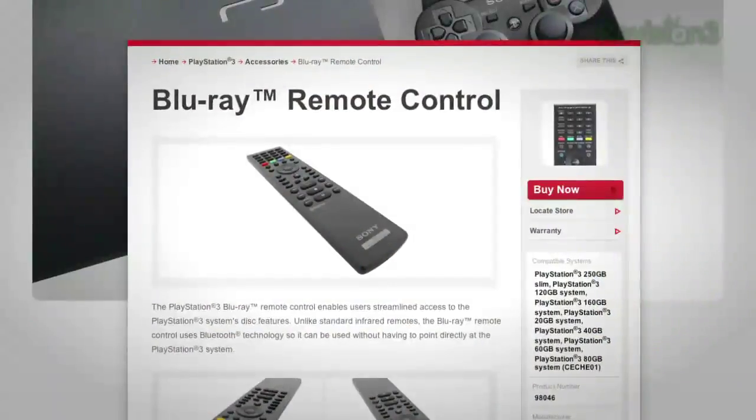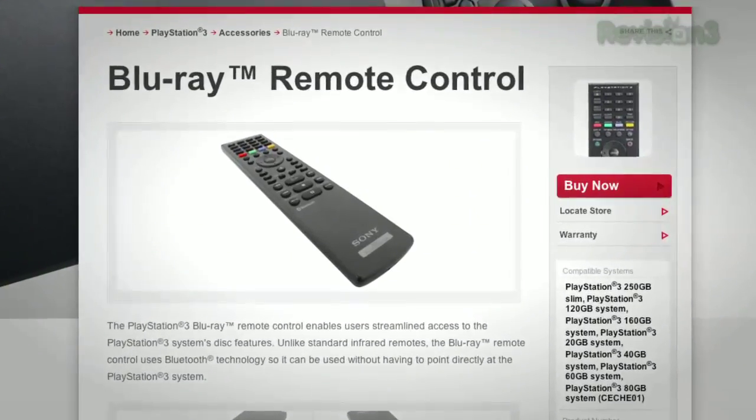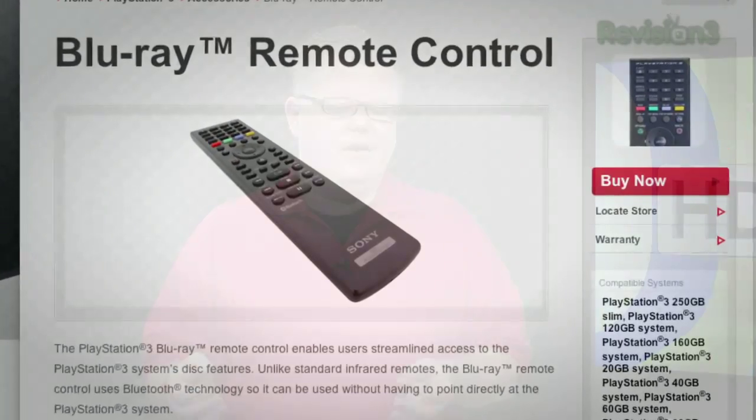You know I'm using that PlayStation 3 Blu-ray remote control — Bluetooth controllers for the player controlling the home theater PC. I found that when the batteries were low, it would detect for the handshaking of the two components, but it wouldn't complete it until I put new batteries in. That drove me crazy — I had to sleep on it, and finally do some searching on the internet. Replace the batteries. So if you ever have Bluetooth-related problems with your devices, make sure you have fresh batteries in the thing, and it saves a lot of problems.